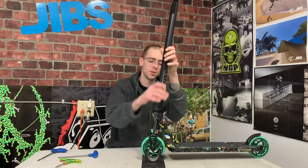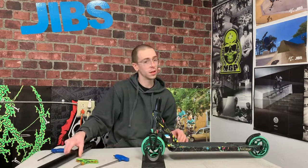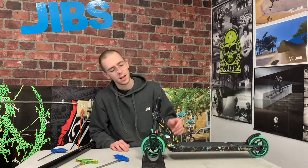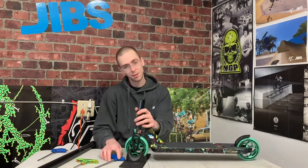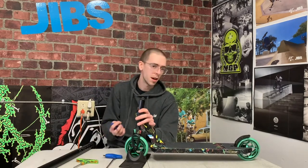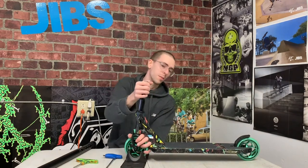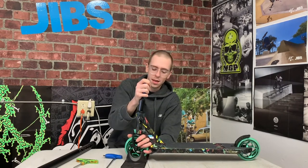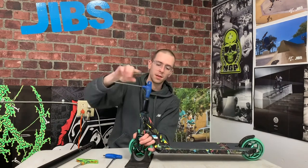Once your clamp is loose, the handlebars should just pull off the compression. If it's an older scooter you might need to pull a little harder — wiggle the bars a little bit — but they will come off. Once you get inside there, you're going to see right on top of the compression there is one bolt. All you have to do to tighten this: put your allen key in — this one is a five millimeter, though some might be six — and tighten that down. You want it tight enough that the steering doesn't move, but not so tight that you can't turn it.